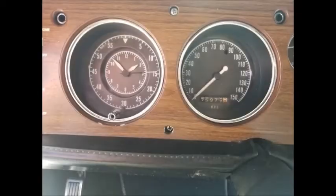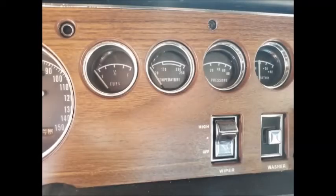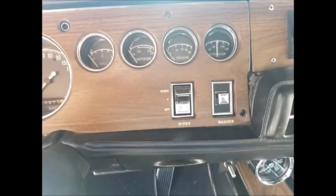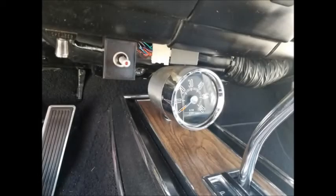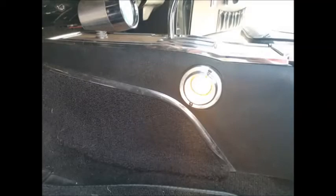Yeah, see, that's another thing. I actually completely redid the compressor, and I got it so it works on 134A instead of R12, and I evacuated it and got it all cleaned up because that's what I used to do for a living, work on heating and air conditioning. The air conditioner will blow you away, so the air conditioning works great. The heater, of course, when I did the air conditioning, I had it all apart. I had the heater out, so I cleaned up the heater core and got it going, and the heater does real good.